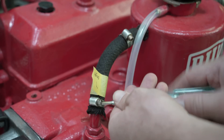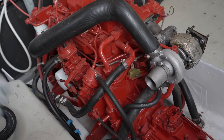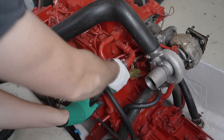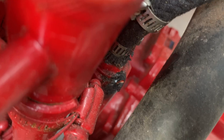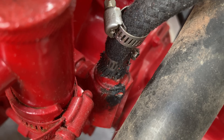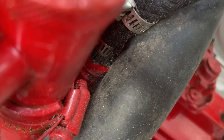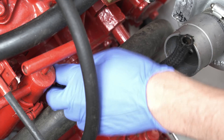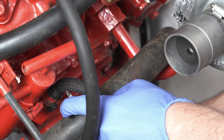The water cooling circuit — a major subject of an upcoming video, by the way — contributes pretty much all the hoses snaking their way around the engine, in and out of both the engine and the boat. It does get in the way, and this is one of three circumstances I've found where it gets in the way too much. One loop of cooling hose is in contact with the engine's dirty air vent and has been slowly rubbing thin with the vibrations. This shall not do. Anyhow, cooling later — let's get the old braided breather line off.